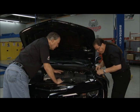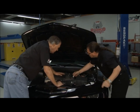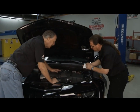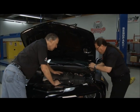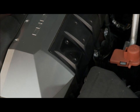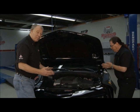Then you test to see how well you've done. The kit comes with a little piece of the same attachment tape used on the parts, so you press that on and see that the tape sticks pretty good. Then you ensure a permanent bond by using the adhesive promoter — a critical chemical, watery fluid. Get a little sponge wet and swipe it down just like so. It dries pretty instantly, and once you have that done, you're ready to put your parts on and do the whole piece.